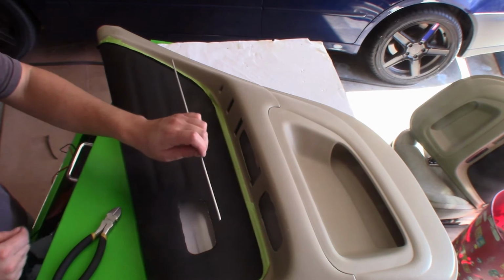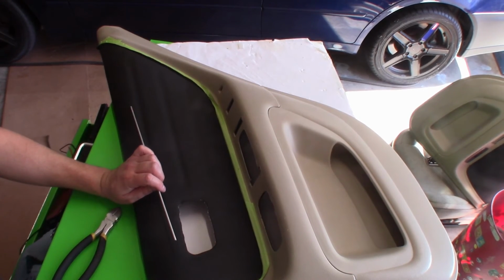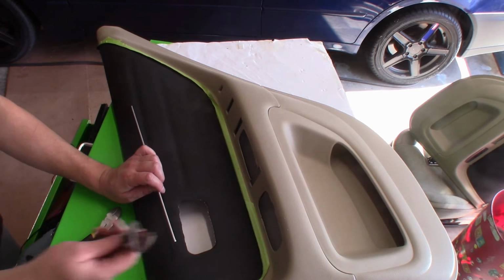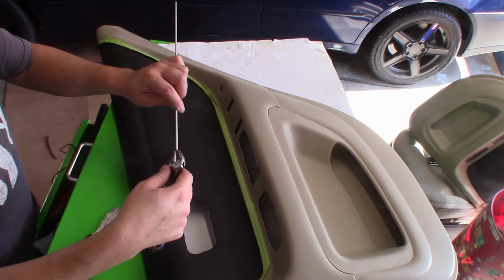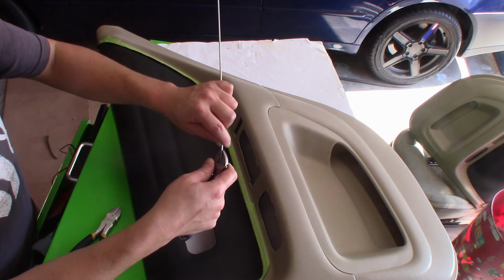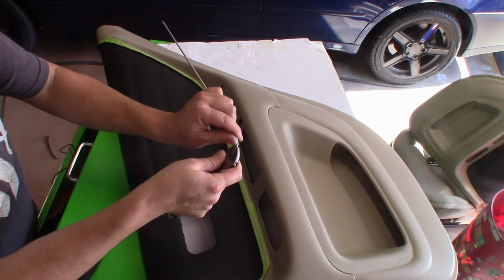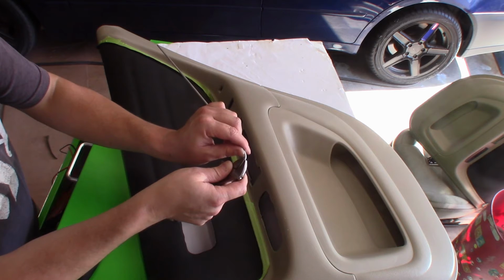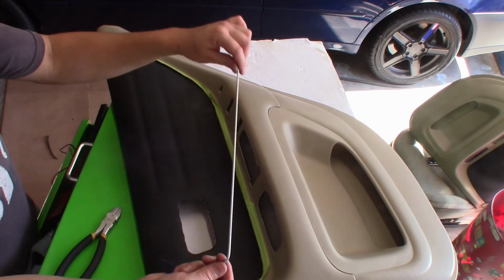that. It's fairly simple. All you're going to need here is maybe a pair of pliers. What I'm going to do is I'm going to use a crescent, and I'm going to grab one end and make sure it's smooth, and I'm going to bend it very slowly, not too fast, because you end up snapping the rod. Okay, so something like this.